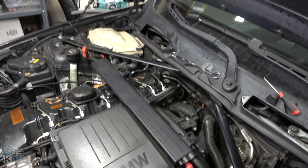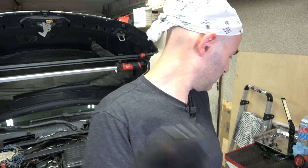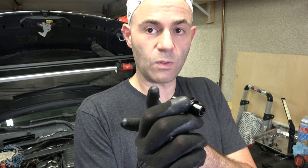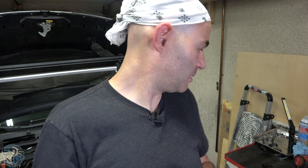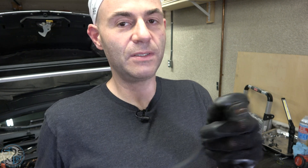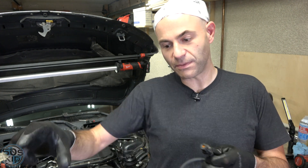The way to test the PCV valve is to see if it's shutting. All valves should rattle if they're not stuck — the new valve rattles, and the old valve also rattles, so it's not stuck open. A good valve is a one-way valve preventing boost from leaking past it back into the valve cover. If I blow this way it should not go through — the new valve is completely closed. But if I blow the other way, there is air getting through. The old valve, when I blow through it with a tube, I can hear air passing — that's your boost pressure going back into the valve cover.